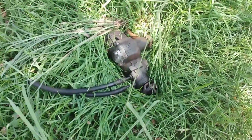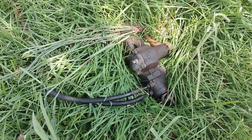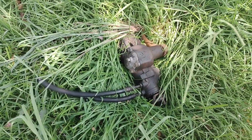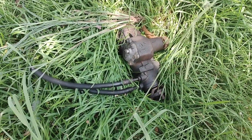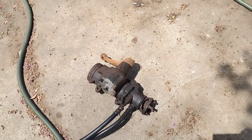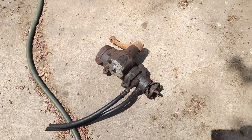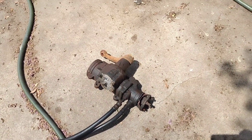Like this gearbox that came out of the 70 Bonneville from season 1 of Nobody Watched It on One Man Garage. We're a part of the 70 Bonneville. That's the variable ratio, which is the quick gearbox. Decided I want to use it on the 69 Firebird, replace the original variable ratio quick box, which should be identical other than the pitman arm.